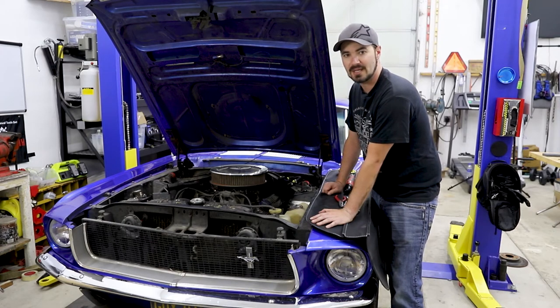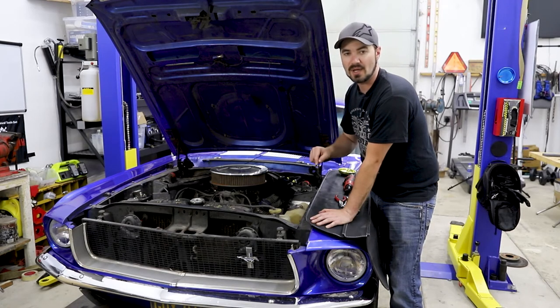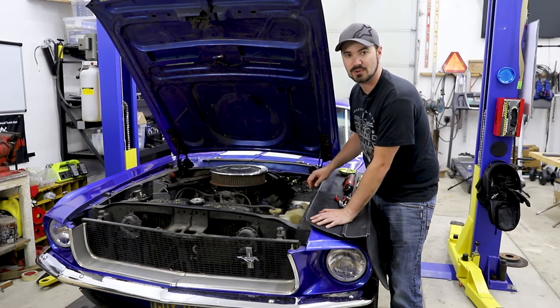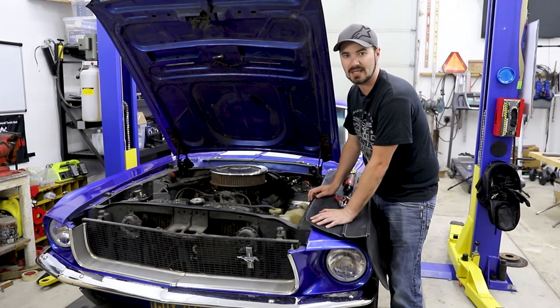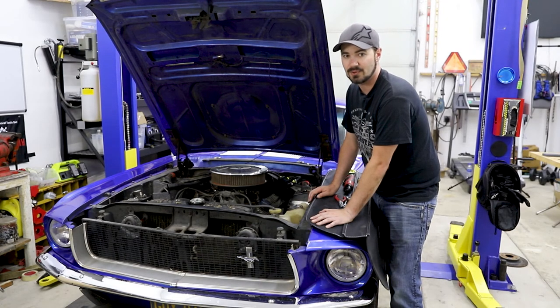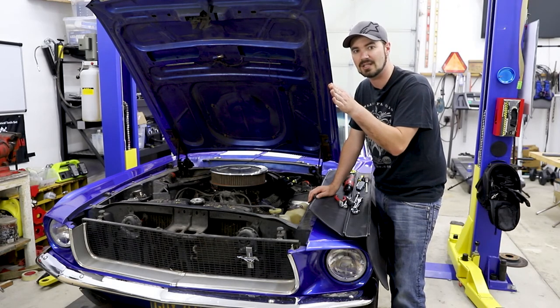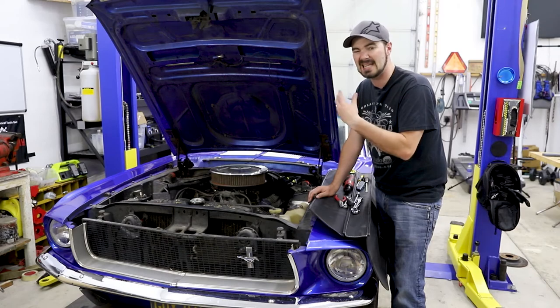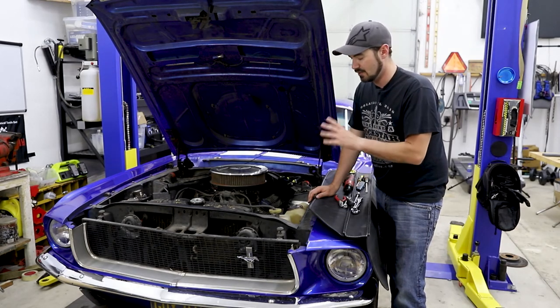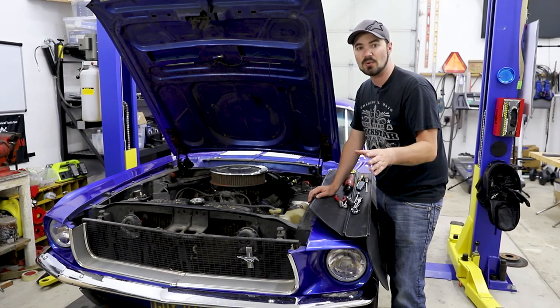The pedal has a good feel to it. I had to replace the brake light switch with a brand new unit I had sitting on the shelf — the one I had modified to work with the previous booster was a no-go, way too loose to engage properly. So it was definitely the wrong booster they sent me before; this is the correct one. The wrong booster likely caused the shaft to be at a slight angle every time the brakes were used, destroying the diaphragm. But it looks like it's fixed, so I'm going to wrap up the project, put away all my tools, and I'll see you all in the next video.